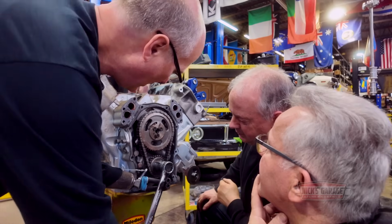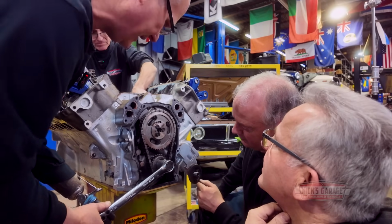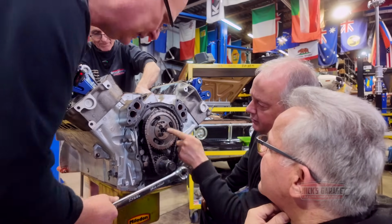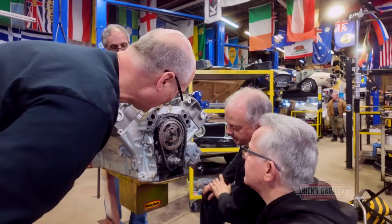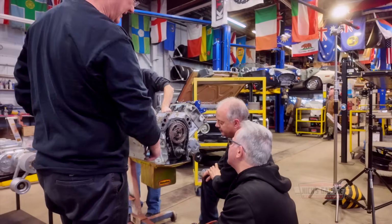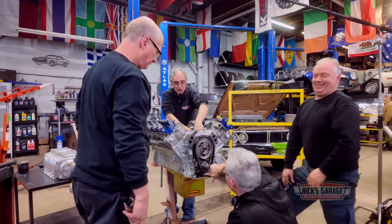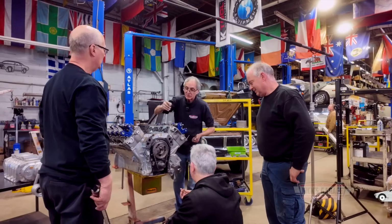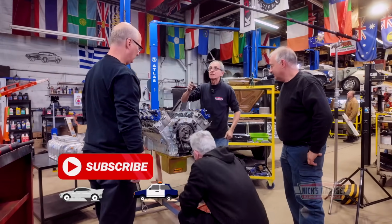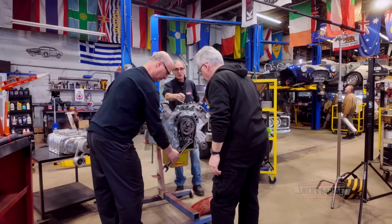And the oil pan is dry. Exactly. There's no way. Keep going, tell me when. It's not on top. So no matter what, it's not correct. Somebody put the timing way off. There's no way it would start like that. Well, that's why I brought it. Sorry, Ross, it may start, it won't be perfect, but the way it lined up is not correct. Unless they used a degree wheel, but then again, it's at the 0 mark, it should be straight up.